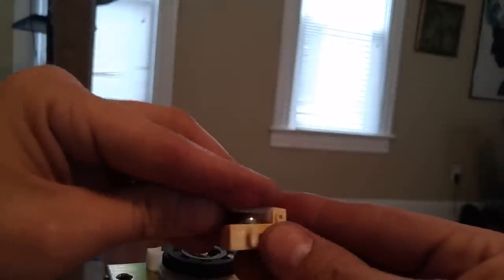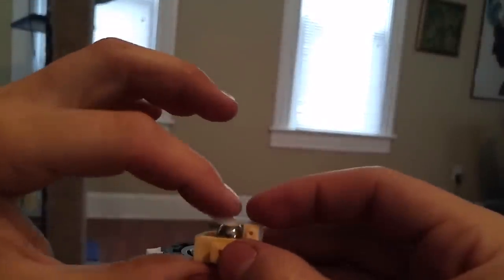After I reassemble this, I'm going to take a little bit of a wax-based lubricant — anything that's dry, like a dry film or white lithium. Just as long as it's not sticky, because this ball has to move freely. It would be fine without lubricant, just for a little extra measure. Thanks for watching and I hope it was helpful — I'll put this back together and get my new Tacoma back on the road.